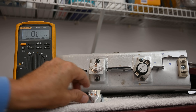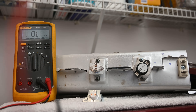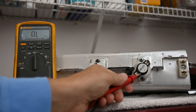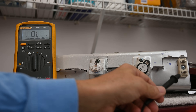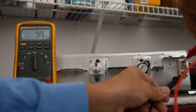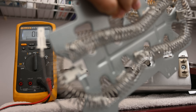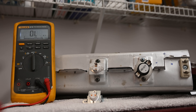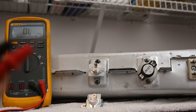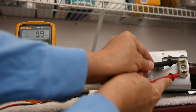The thermostat shows continuity, so it's doing fine — but having continuity now doesn't confirm it works correctly under temperature, so take that with a grain of salt. Testing the heating element: it should read about 10 ohms. You can see it reads 9.9 ohms — the spring coil winding adds up to about 10 ohms of resistance. You should never see OL when testing the heating element; if you do, it's broken.